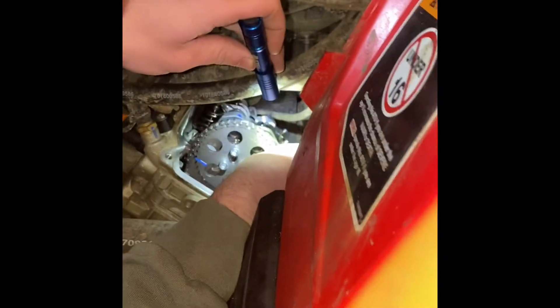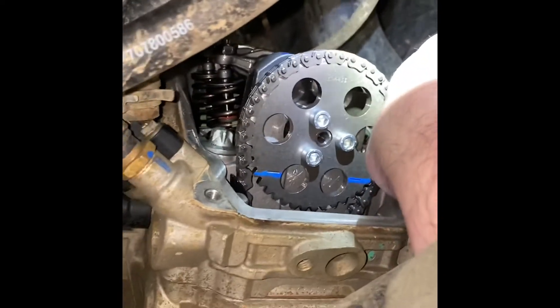The valve clearance check starts on the exhaust side. You just kind of run the feeler gauge in between — you don't have to come from the top and shoot down at it. For the exhaust you just kind of want to run it through here, and I'll put the tolerances in the link below. It fits underneath there really snug — and that one was five thousandths of an inch.